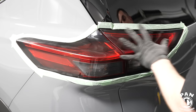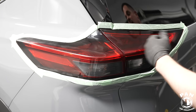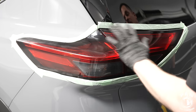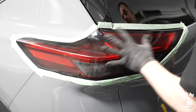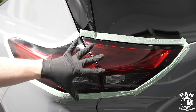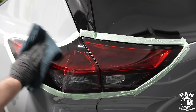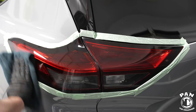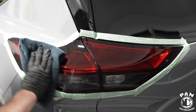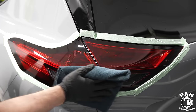That's pretty much it — just a few minutes of polishing and the results should be pretty good. We're going to let the polish cure for the required 15 minutes, then come back, buff it off, and check out the final results with the inspection light. Hopefully we removed a lot of the defects — the swirls, scratches, and light oxidation — improved the gloss and clarity, and gave them up to one year of ceramic protection. It has now been 15 minutes of curing for the Rupes Uno Advanced, so let's take a microfiber towel and buff off the polish. It's an easy wipe-off with little to no dusting.